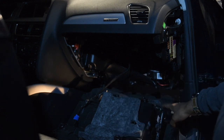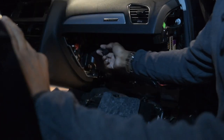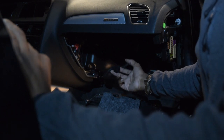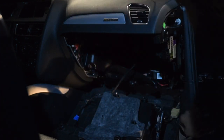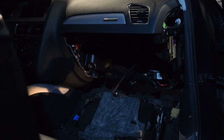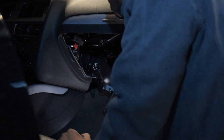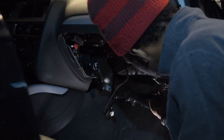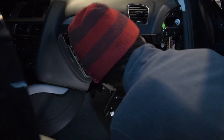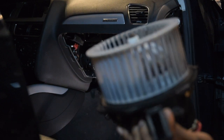There are a lot of wires running into the glove box. This connector here goes into the back of the AMI box — pull it out so you can set the box aside. What we're going after is right here and you can easily get to it. The old motor just literally twists out. Upon further research, I found out you also have to take out the resistor, which is right here.